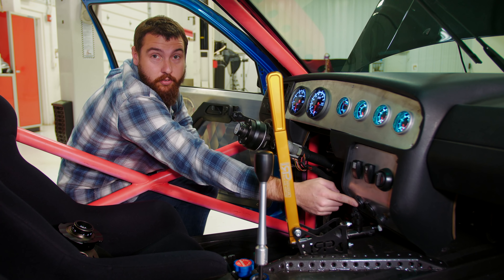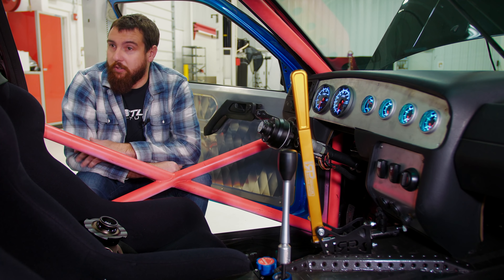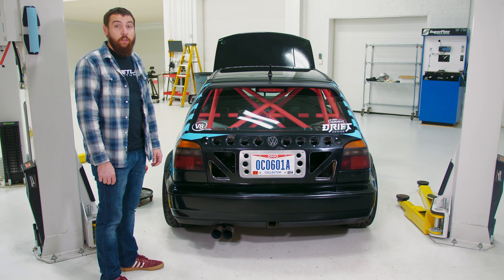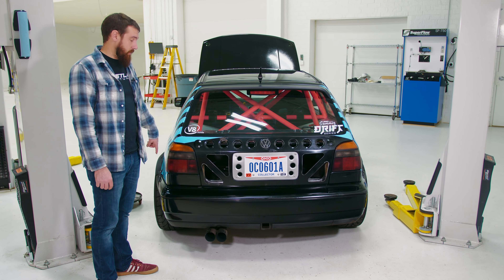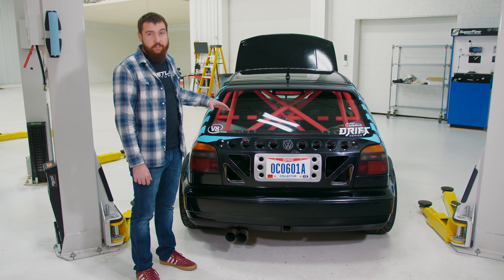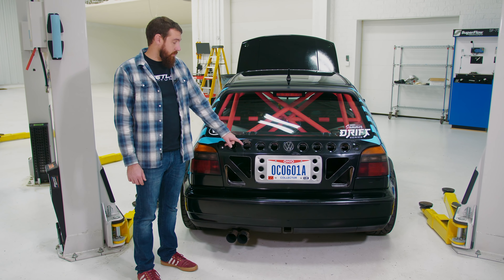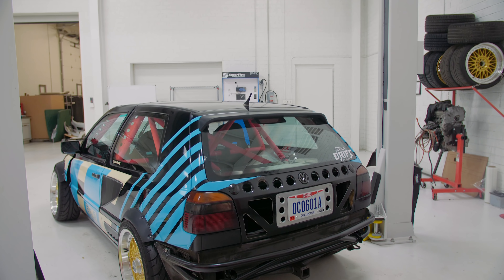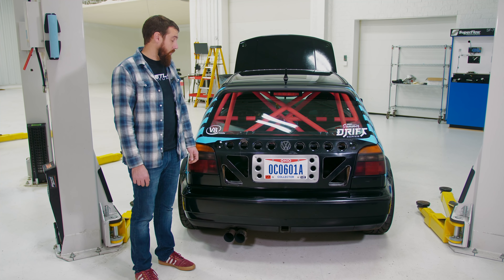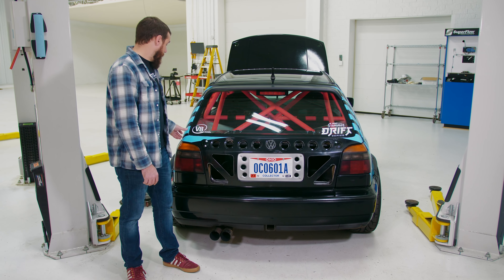I've got the Turner short-throw shifter with the rally lever, which keeps your hands from reaching all over the cabin trying to shift gears. I had to go with a Wilwood pedal box because I cut the firewall out for the engine, and that's where all the factory pedals mounted — it was easier to go with a full pedal box assembly, which gave me a nice brake bias knob for front and rear adjustability, because who knows what this is going to handle like. I've got Pro Sport gauges to keep a tab on everything. The switches give me fan override — I like fans to come on when it's actually going to overheat, but I can manually turn them on permanently if I want to cool it off faster.